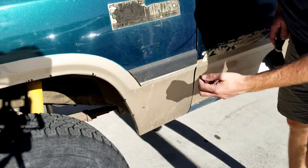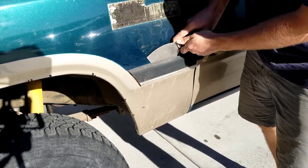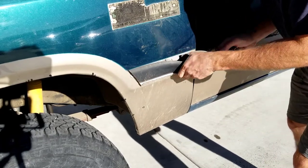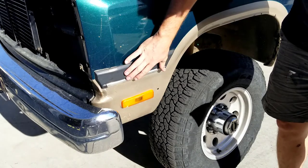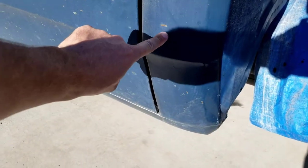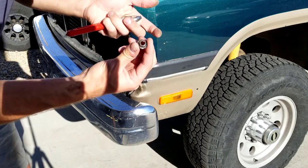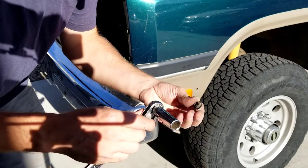I've got a video on my channel - I'll link it above right now - of how to take this molding off. I'm going to see if mine comes off in just one piece. This front piece of molding has two kind of plastic nuts on the inside of the fender, so I'll undo those and then pull it off. It's taped in and has those nuts on there. If it's a single cab, this back piece will have the same thing, and an extended cab usually has that too. The nuts are half inch - I was using a crescent wrench and that was going slow, so I got a half inch socket.